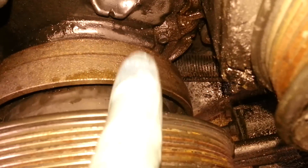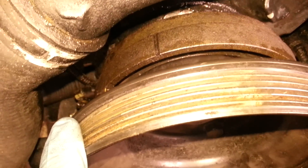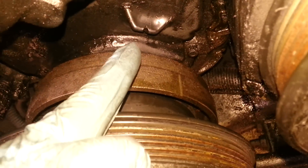I'm pretty sure I'm not the only one who, when you look at the crank at the harmonic balancer, you see one, two notches — which is ridiculous. You're looking like, that's not normal, which one do I line it up to? You line it up to right here — not the first notch.